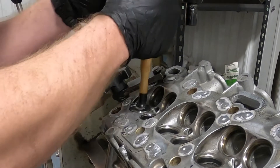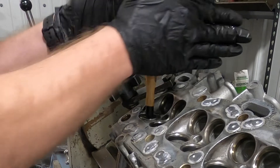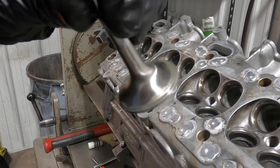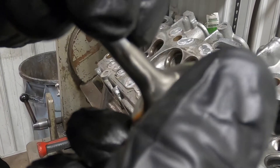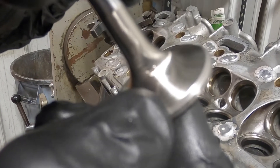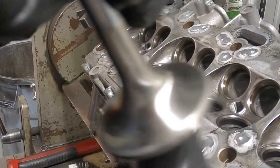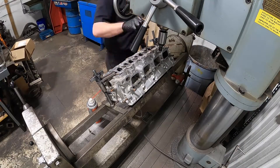To confirm that our tooling setup was correct, it's just like a little abrasive compound. You scrub the valve in on the seat and then it will leave a line on the valve where the seat actually is. As you can see here once I wipe it off — the gray, dull part is the actual seat contact on the surface. I know the picture isn't that focused for a while, but you get the idea.